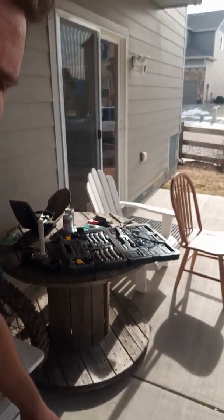So what you need to do that swap, and I'm going to be putting this all together here and show you as I go through it all once it's all assembled, is a YZ125 or YZ450 or 250 front wheel. Any of those wheels will work. You need the axle and you need the nut. You're also going to need the forks and to machine the triple clamp. Overall, after everything's said and done, I've spent maybe $400. Probably around $330, $320 for some really good quality forks. I'm going to go over that when I get to it.